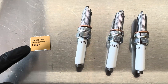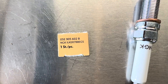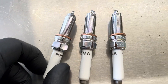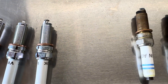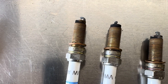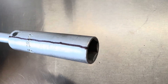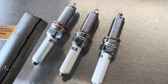Here's our setup. These are the plugs I'm fitting — genuine Volkswagen NGKs, and you can see the NGK part number is really long. I know you can normally decode an NGK part number, but that does seem even by their standards a bit excessive. I've marked with a sharpie the point on the hex where it aligns with the ground strap on each plug. These are the old plugs and if I'm honest they look a bit over-tightened because this copper washer is quite compressed. These ones are Bosch — I don't know whether they're factory or changed by a dealer. And I've got the genuine Volkswagen tool, marked in the same place so that's going to align with the ground strap when we put it in.